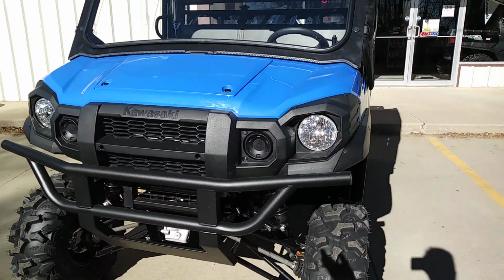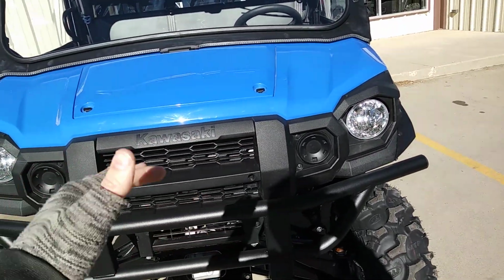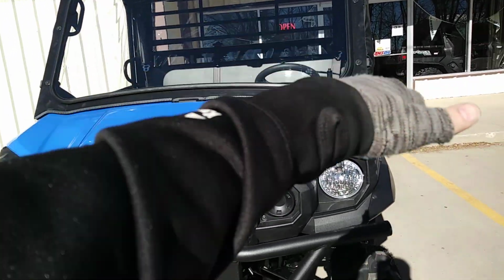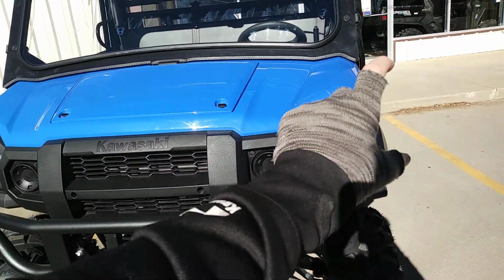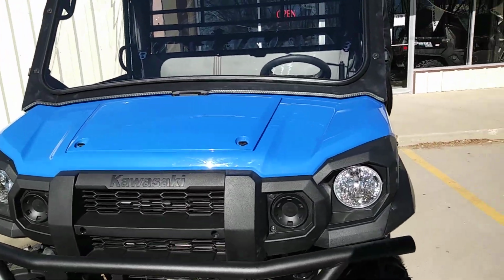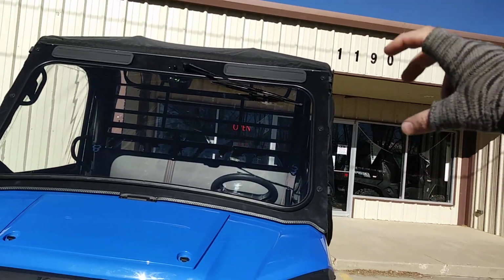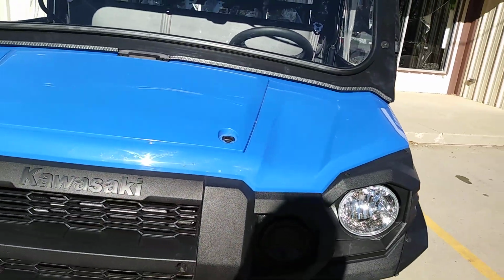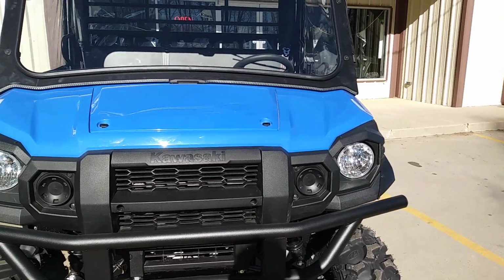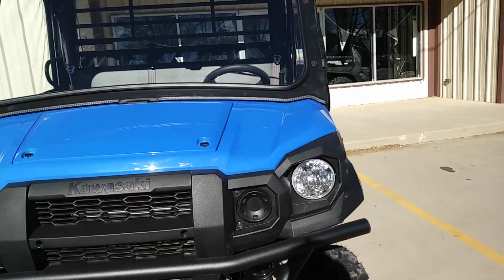Before I get phone calls and questions, tell you a little secret. It's really simple. Granted, it's some work. You have to do it. But, you know, if you have a windshield, you're going to have to take it off. You're going to have to unbolt this entire front end, take this whole front fascia completely off, unbolt this, lift that up. What we do is we just slide it up the roll cage, use some tie-down straps just to hold it up. Then go down to auto parts store or even on eBay. You get the sheets of sound deadening heat shield. So it's waterproof and it's self-adhesive.